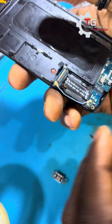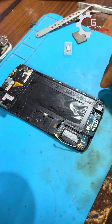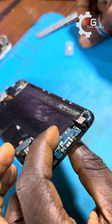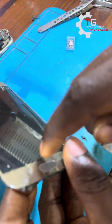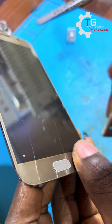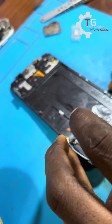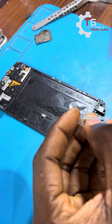Let's listen to the click of the home button — it's still clicking, so it's perfectly okay. Again, the reason why I put the shield at the bottom is because of the screen — because of the heat, I don't want anything to happen to this screen. So I have to be very careful, and what I'll be doing is fixing the charging port with my soldering iron.